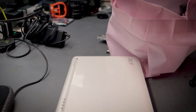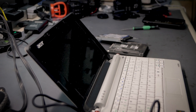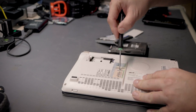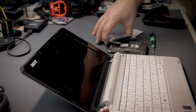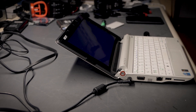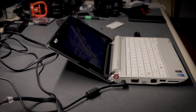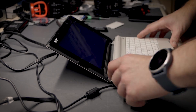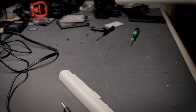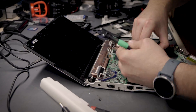I went to the Aspire and was hoping to boot it from DBAN to show you how DBAN works, but unfortunately DBAN wasn't working on this particular laptop because there's a problem with the SD slot — it can't get past it unless I disable it in BIOS. So I just got the drives out and disassembled the whole thing, which was a pain because this model doesn't have a door to access the drive, unlike the one I have at home.